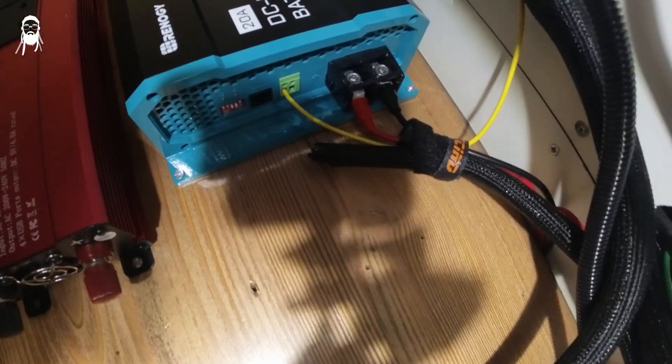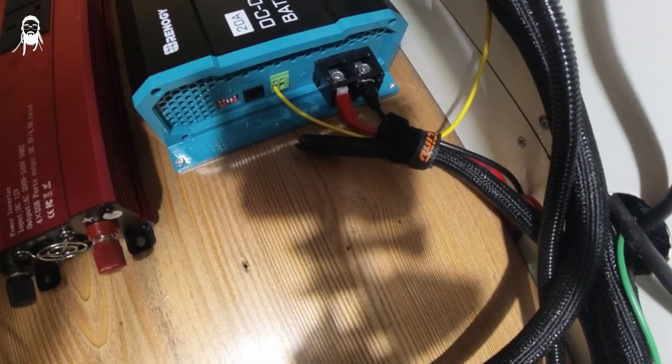Now let me show you the mystery cable. It goes into the green connector — I think it's D+. That goes to a 12 volt ignition source, so when I turn the engine on it fires the system up. It doesn't power it; it just tells it the engine is on. I hooked that up to my cigarette lighter at the front, so that cable goes all the way into the cab. Make sure your cigarette lighter isn't a permanent 12 volt or it will drain the battery. If it's always on, it's probably permanent, so you need to find an ignition-switched 12 volt.